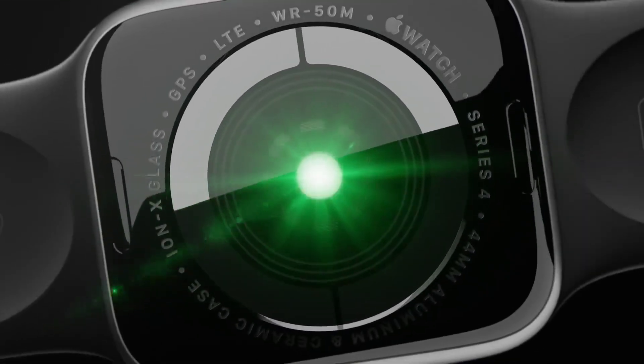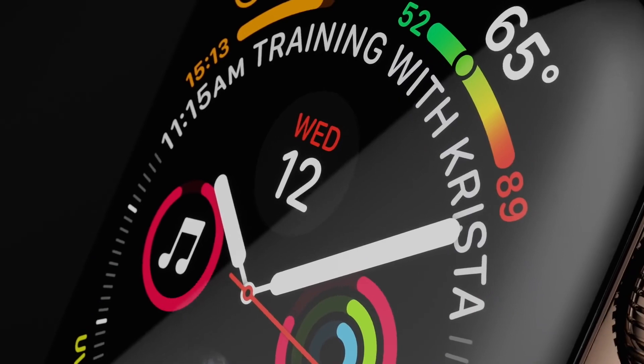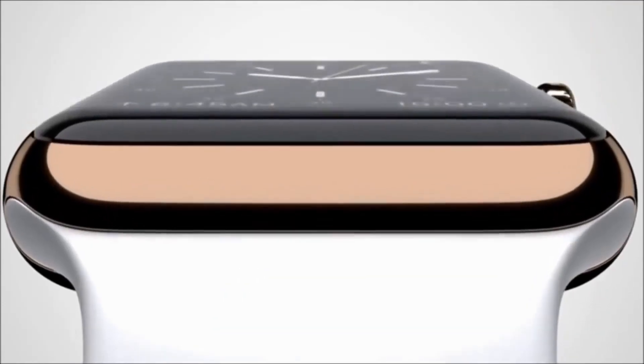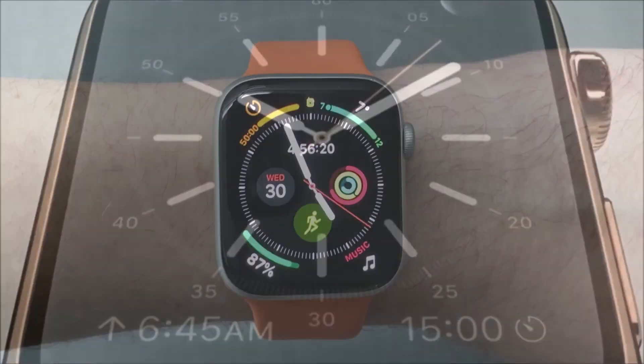When your Apple Watch's battery isn't lasting long enough or not getting you through the day, the first thing I'd recommend is a simple restart. Sometimes apps or background processes will crash and get stuck in a loop causing your watch's processor activity to run high. This type of situation makes your watch go through battery power fast, and a simple restart is all you need.